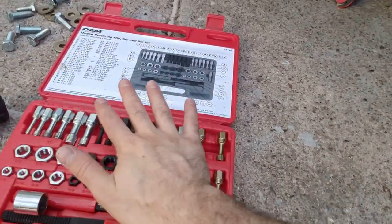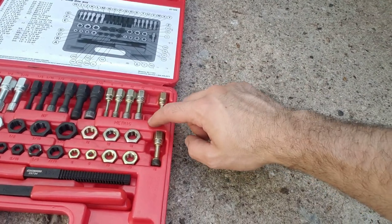The threads were just super rusted. So if you're trying to install a hitch on a Honda Ridgeline, this will help you — they're 12mm 1.25 bolts, three on each side, and then the two right behind the bumper are 10mm 1.25. The 10mm bolts were super clean and went right in, but the ones on the sides are kind of rusted. So I rented a tap set and I'm using the 12mm 1.25 tap to clean out the holes and put the bolts right in.